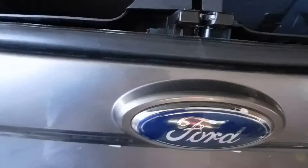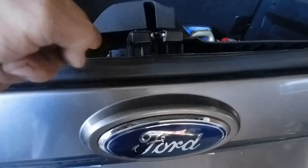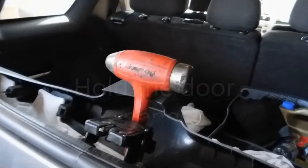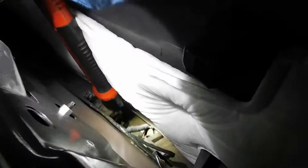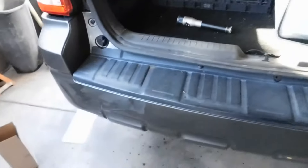You're going to put your hand in at the logo area and go straight down to reach the bottom. I'm using a hammer just to hold the plastic away so I can put my hand in. Right where you see the light is where I have to reach under to unlock and open the door. And there — it's open now. Make sure you remove the prop so it doesn't hit you in the head.